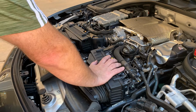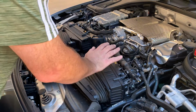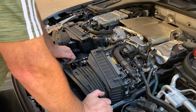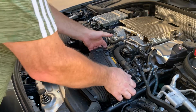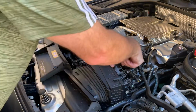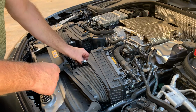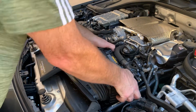So here's the air box for the air filter. What I found was more difficult is normally I would take out these screws here, but there are 2 identical ones underneath and I couldn't get to them. So again, just looking around, start pulling on this a little gently, and you'll find that there's an area right under here that just pops down, one right under here, and then right on the other side right here. You can't see that in the video, but it's got a rubber cap on it. So what he did is just got under and started popping that up.